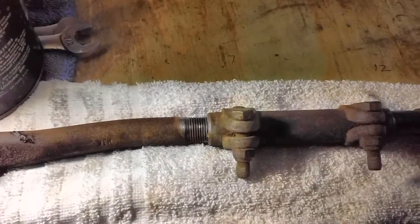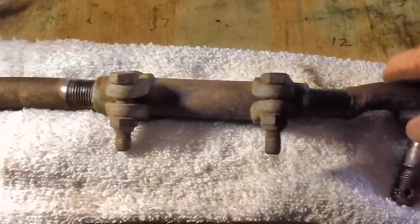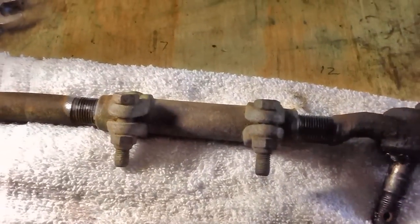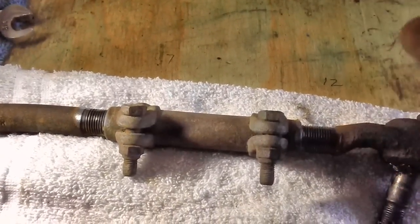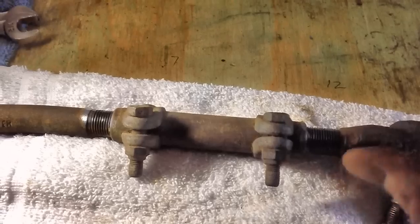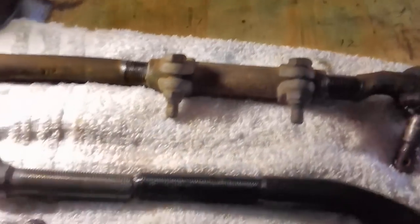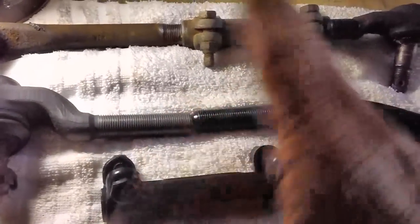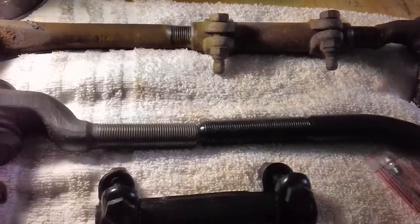That's the only way you can do it, to get it as close as you can to the way it was when it came out of the car. And even then it's not going to be right. Because we put new ball joints in, new bushings, new sway bar links, new shocks, and this car's never been aligned as far as I can tell, so it's going to be off, and we may have to go back under there